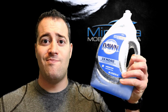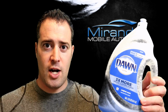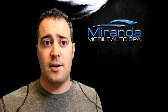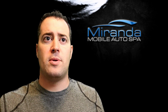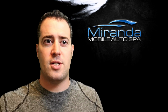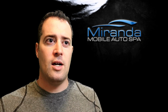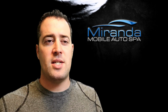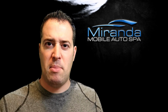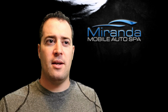So no surprise, I like to use Dawn to clean the pads. Now I switched over to Dawn, and I'm going to let you know why. I used to use a strong all-purpose cleaner. I had Meguiar's all-purpose cleaner. I was using 3D's Orange degreaser, and a few other degreasers and all-purpose cleaners. And they just seemed to be a little too harsh. Even mixed at a 1 to 10 dilution ratio, they were just a little bit too harsh on the pads. I think it was actually starting to wear them out a little bit.